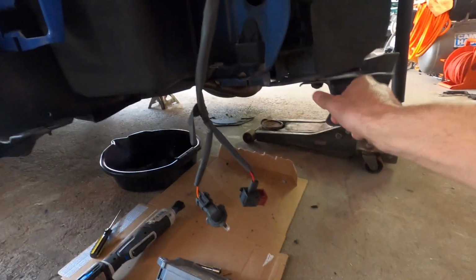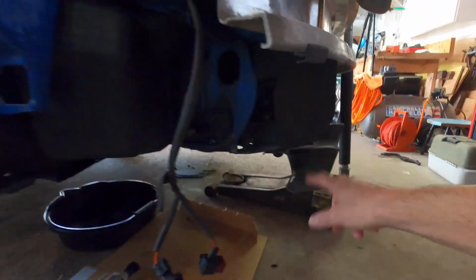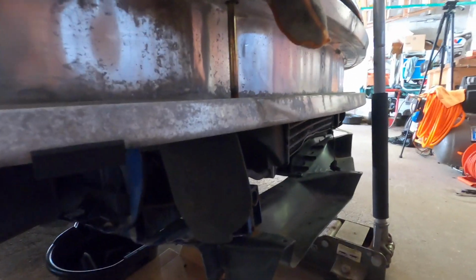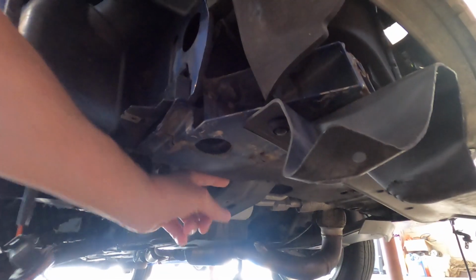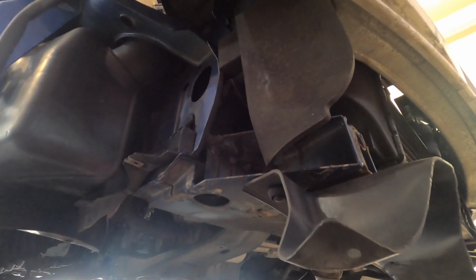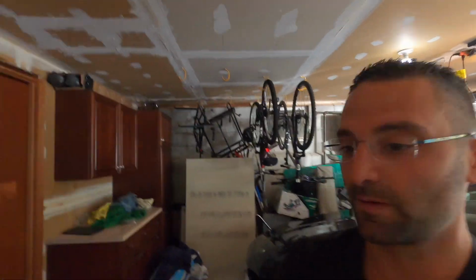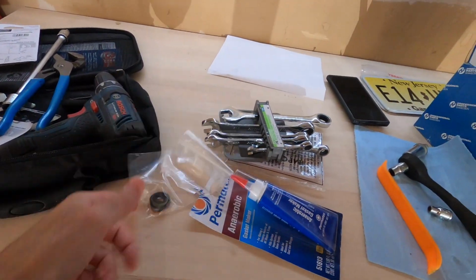Like I said in another video, this plastic shield, I took off most of it on this side. Just kind of button this up here temporarily, just to keep some room. I already removed the subframe bolt here. This has to get pulled down to make room to pull the pan down. So the pan literally in like 10 minutes is ready to come out. Literally.